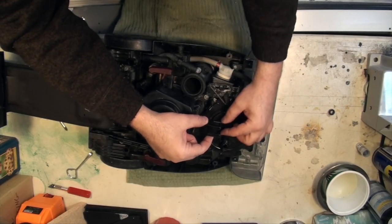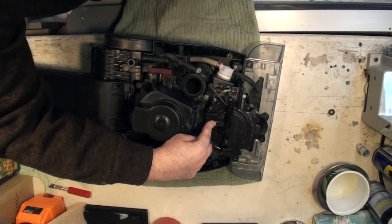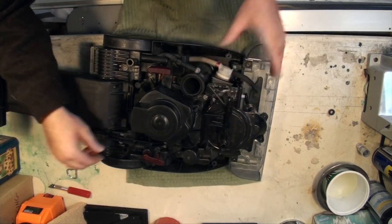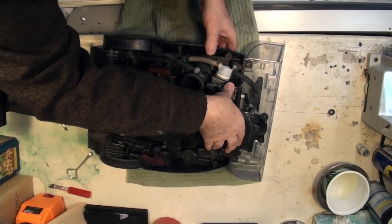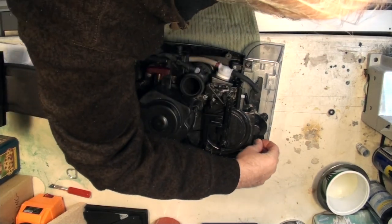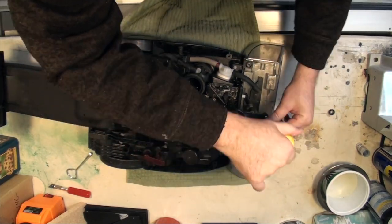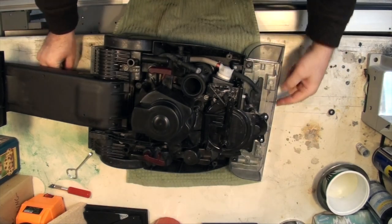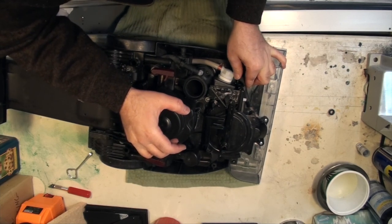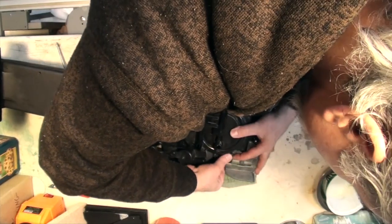While it's still loose, take this lever and engage it with the interlock so that when the handle goes forward it engages properly. Press it down to confirm it's in good shape. Two screws go back in from this side — one here, one here. Now reconnect the hoses, making sure they slide on far enough to be solidly engaged. The last thing we need is more leaks — same thing on this side.